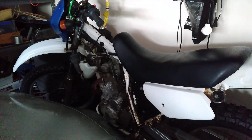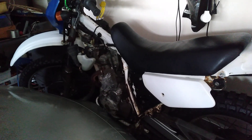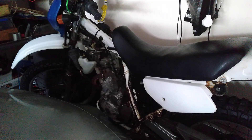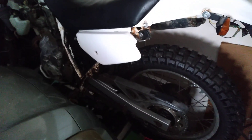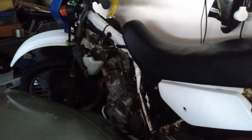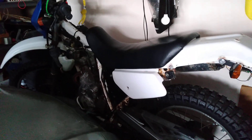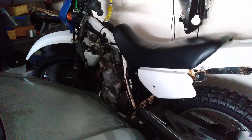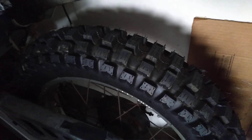I tipped the fuel out from the filler and it came out looking pretty nasty - a bit muddy and dirty - though there was no rust in the metal tank. I took the petcock off - it's an 18mm thread that screws onto a nipple on the bottom of the tank - and it was really nasty inside, as was the little plastic tube above it. I've bought a brand new petcock and it should be here shortly. I did manage to bypass it and had the engine running beautifully, which confirmed it was just fuel starvation. From now on I'll be draining the tank and carb bowl completely dry when the bike sits unused, as it can sit for months - nearly a year this time. The tires had virtually no use at all.